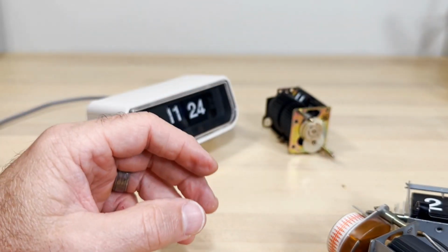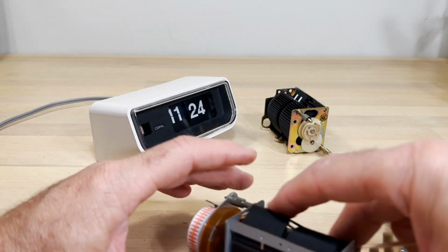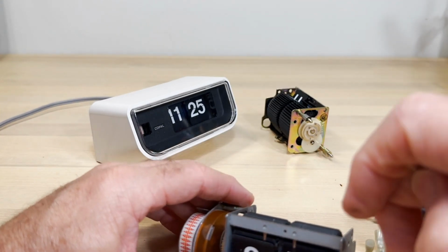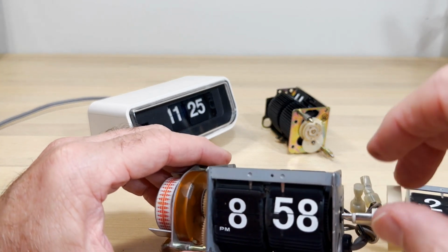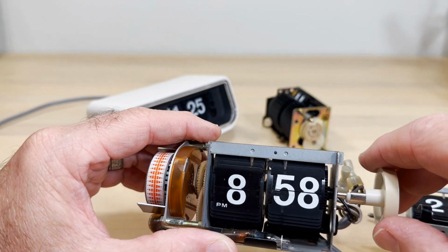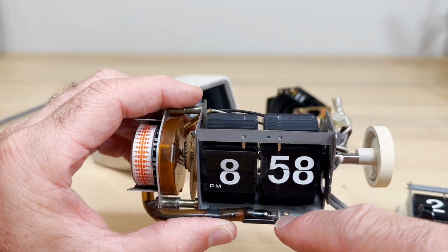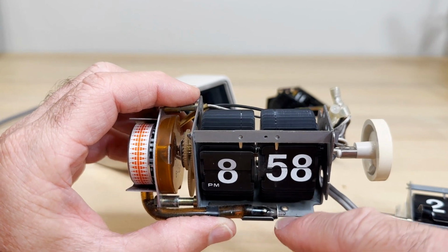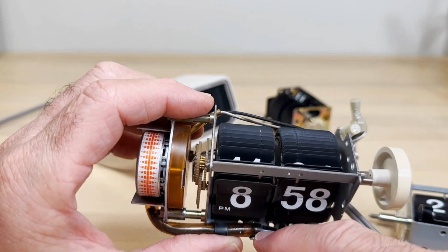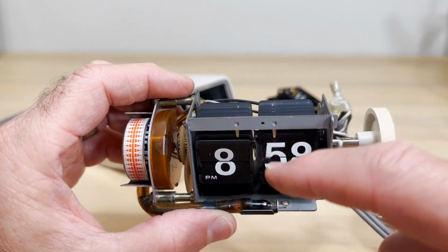Now there's another for your regular Panasonics and stuff like that. They use a 15 milliamp 12 volt bulb, and again I'll include a link to where you can get those. Those two are the most common, your C2As, neon glow bulbs, and that's what you'd look up online, neon glow bulb. Some call them neon lamps. C2A is the indicator, NEH2, that's the old style.